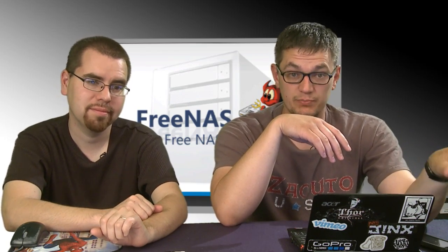It doesn't matter. The point is that I'm not using the same size of drives in every single one of them. That's the part that I want to make sure works, because in reality, I don't have the money to put 2 terabyte drives. If I had the money, I'd put 3 terabyte drives in all of it, because this box will take 15 terabytes if I expand. Right now, I'm putting in 2 terabyte drives when I can afford them, and I've got 2 1 terabyte drives that are in my media server right now that I'm going to put inside there. And when they die or when something else happens, when I can expand, I'll pull those 1 terabytes out and I'll put 2 or 3 terabytes in there next time. Yeah. And that means I can expand. I'm in a RAID. We're good to go.